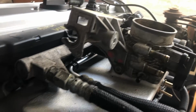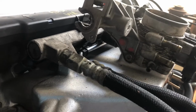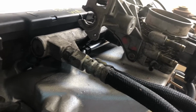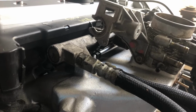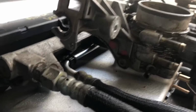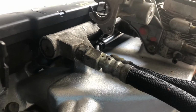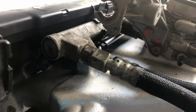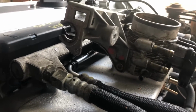And then obviously you've still got the inherent issues that will happen with MAF sensors, lambda sensors. There's so many sensors on the standard engine that effectively could and do go wrong, which then cause running issues. You've got pressure sensors, you've got barometric sensors, which again can play havoc. It does have electronic throttle, which is great, but as I said, we're going to convert to a cable throttle, standard TPS potentiometer, and give it a go and see how we get on.